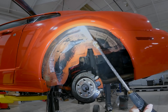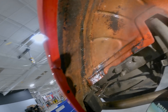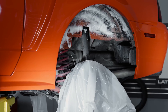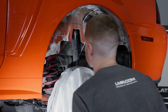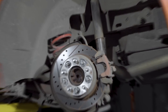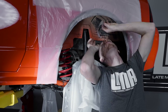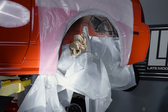After we got all the undercarriage sorted, we moved to the rear fender arches and spent a little time there. We kept applying our cleaner degreaser — the suds were still a little brown, so we hit it a couple times until the suds turned white, which means it's not pulling off any more dirt. Once that was all nice, clean, and fresh, we let it air dry really well. We masked the entire area of the body of the car and any suspension or surrounding areas that didn't need undercoating, then wiped the fender arches with isopropyl alcohol to get it ready.